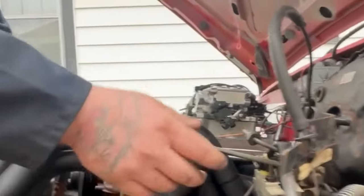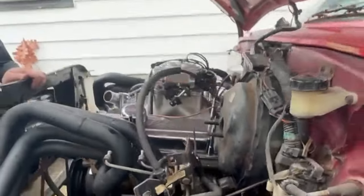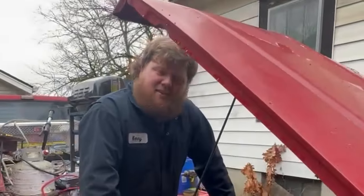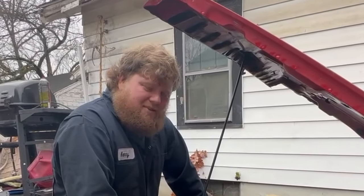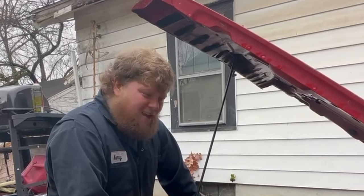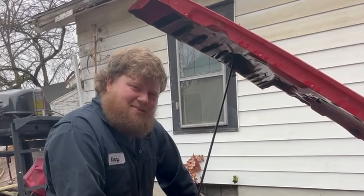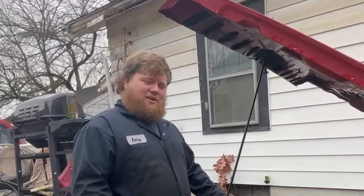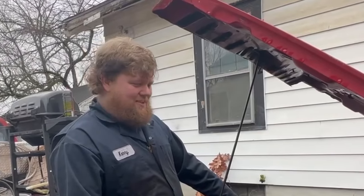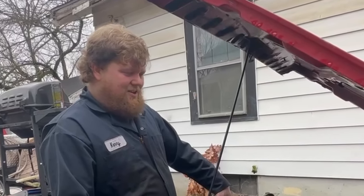It's already had brake lines patched on it. It's got copper lines under it, which there's nothing wrong with copper lines. It's just I'd rather have a solid continuous line, whether it's stainless or epoxy coated, whatever, I don't care. I don't want unions and compression fittings if I'm going to drive this thing as fast as it's capable of going, so I'd rather fix it the right way and delete all of those unsafe options. I've used unions on my daily drivers, but I don't drive my daily drivers over 100, so that's okay.